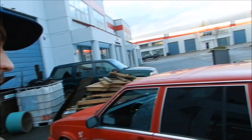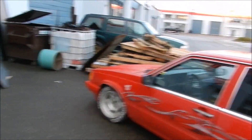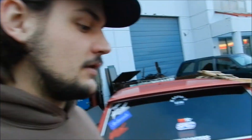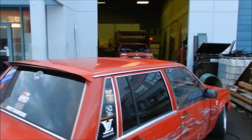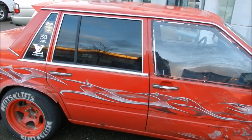If you guys remember, I cut the muffler off Miss Huff right before the ice racing event - I just wanted it a little bit louder, maybe a little bit too much louder. But it turned out to be pretty fun. Dailying this around for the last two weeks though, it's getting a little bit obnoxious. We want to do the side pipe just for the look anyway - I like the look of a side pipe - and go with 2.5 inch rather than the stock 2 inch to open up a little bit of flow.